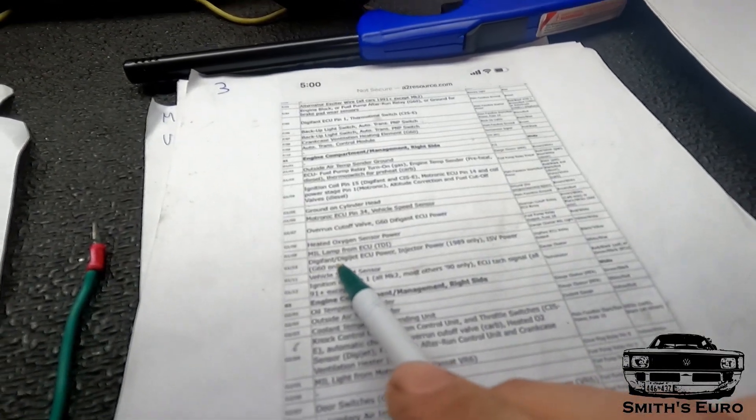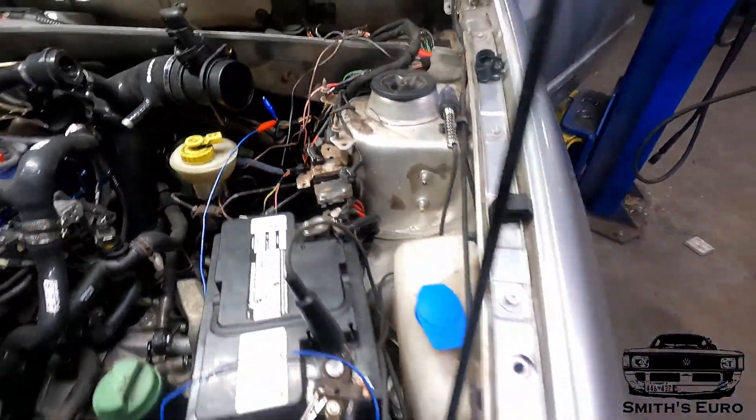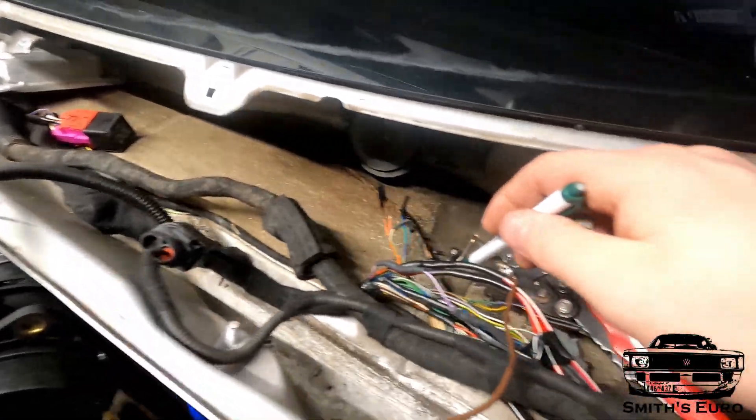That's a really, really big result right there - I'm really happy, I did not expect that to work. Now we know that whenever you do this type of swap, keep things as OEM as possible, which I'm trying to do - you can do it. G110 - so that's the check engine light, black and yellow wire. You just connect that G110 wire, which I have coming out here, jumped all the way back up to where this orange connector was - yellow and purple wire, purple and yellow wire - connected to that and you get a working check engine light. Now when I go to emissions it'll scan right through.